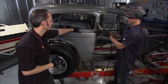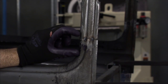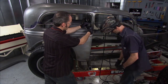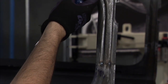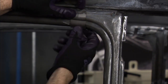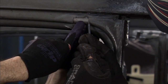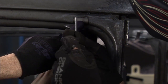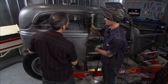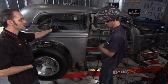Got that tacked in — that looks good. Now he's got that in. What we were able to do is take a section from what we cut out here. You can see we've got a little gap piece — we need to make a filler. We could use that same kind of shape and rework it around a little bit. And voila — hold that in there. Make sure we've got our inside bend lined up and scribe away. You want to overlap and scribe — it's always the way to do it. Then you'll have a nice, clean scribe cut right to that line, butt-weld it in. Start cutting and we'll be done with that piece and ready to move on.